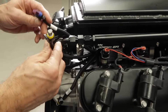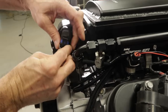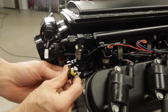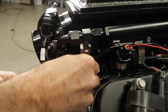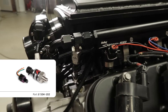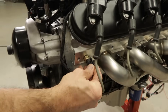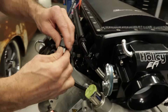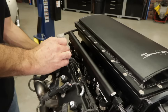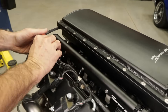As we work our way around to the front of the engine, you'll find the TPS and IAC connectors that are found on the throttle body. You'll also find provisions for the optional fuel pressure sensor — I'll be using one of Holley's 0-100 PSI transducers, part number 554-102. Don't forget about the coolant temp sensor, which is typically mounted in the cylinder head. There's also a manifold air temp sensor, which should be mounted in your intake manifold for proper operation. Now we can connect the EV1 coil bank to the harness and all of the injectors on this side.